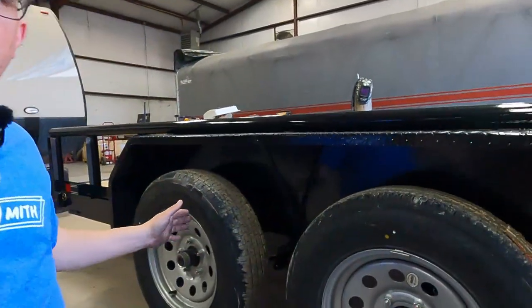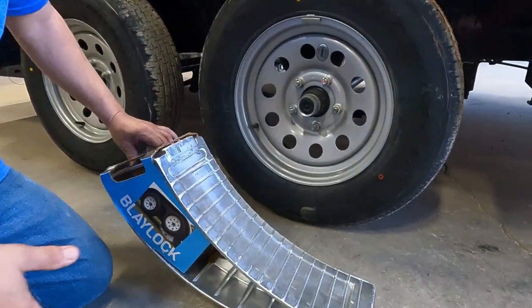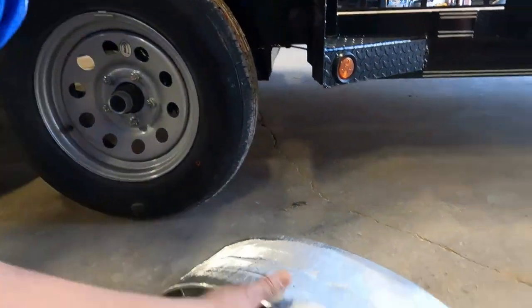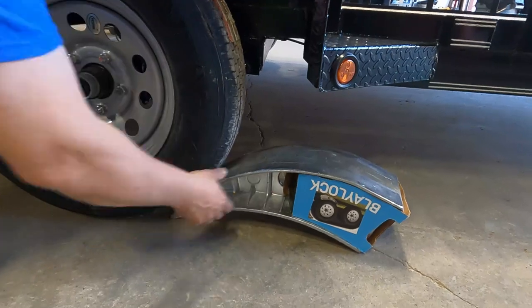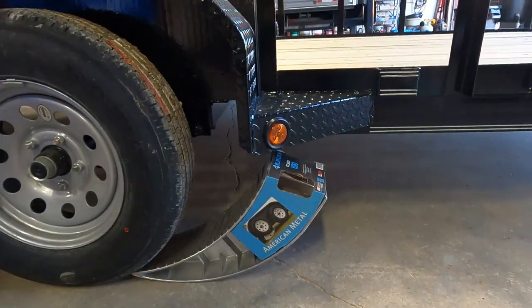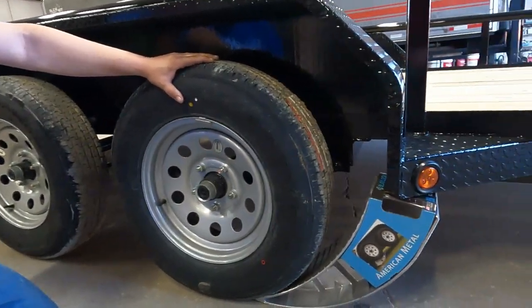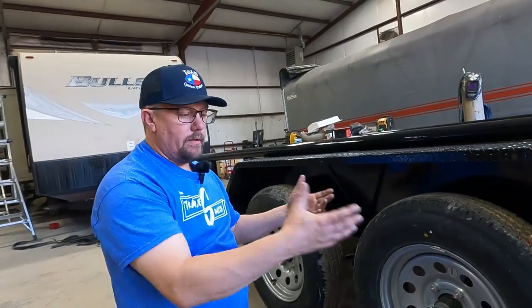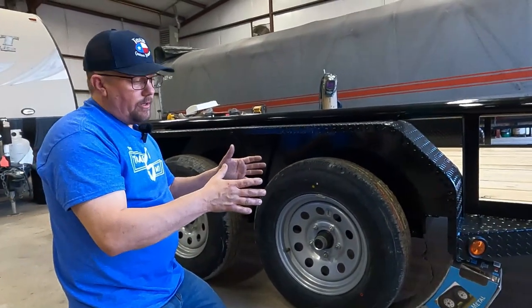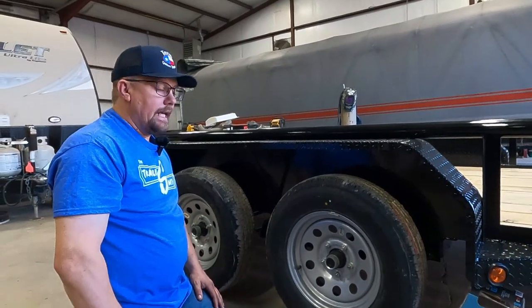Maybe you've bought yourself a tandem axle trailer and you have a flat tire. Well, you're in luck — they make something pretty cool. It's the EasyJack 100. It works a couple of different ways: you can use it as a wheel chock in either direction. But if you have a flat on one of these tandems, you put it underneath your tire, pull forward, and it will rock the trailer up and lift it so you can change the tire without having to jack. Put your tire on, then take it back off. You can put it on the rear axle as well and just put it in reverse. I've used it a couple of times and we sell a lot of them. We keep one in our shop truck — if we're taking a trailer down the road, they're pretty handy. It's better to have it and not need it than need it and not have it.